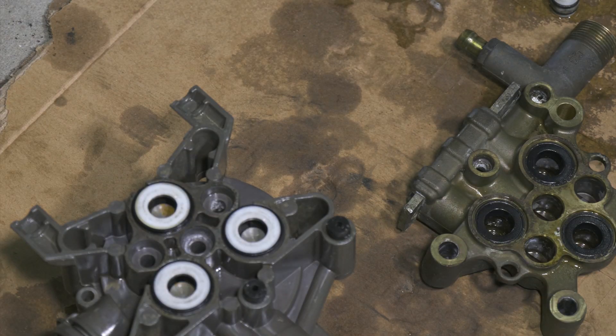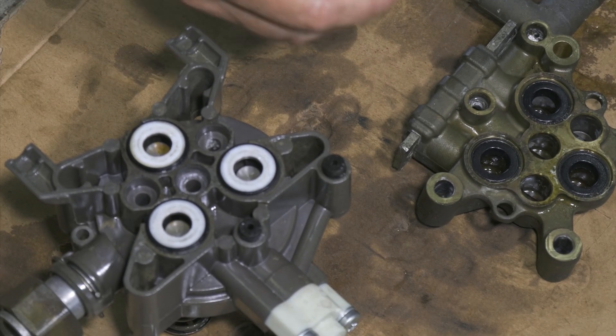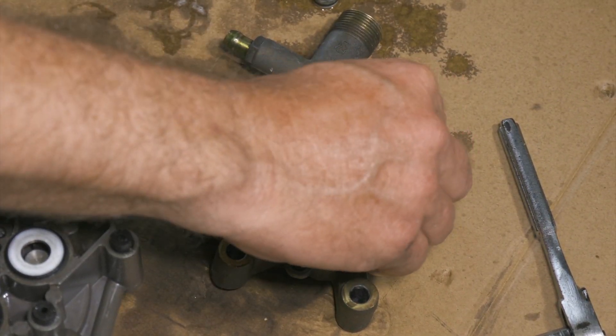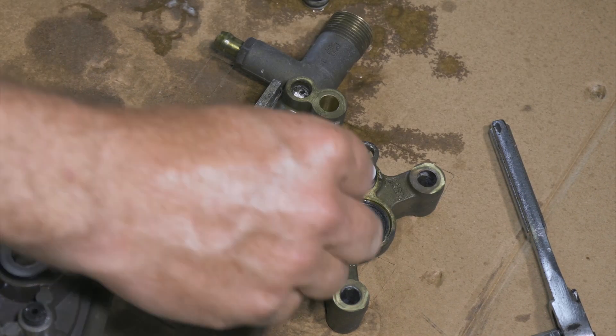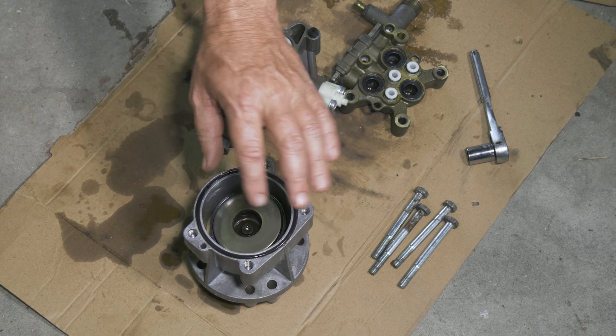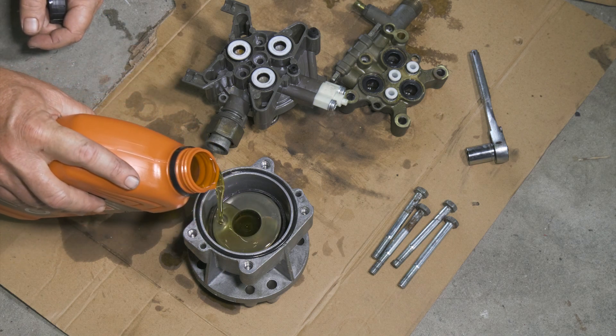This one we want to put in face up — it does have a lip on the bottom so we're going to have to walk that lip in. I'm going to use a little flat head screwdriver and kind of pinch it in on one side and then keep working it through. These guys here went down into these grooves — we'll go ahead and lube these up too. We're going to go ahead and fill up this piece with oil — regular engine oil because it is what we have. Probably best would be gear lube but it should do the trick.